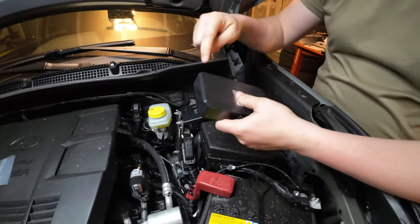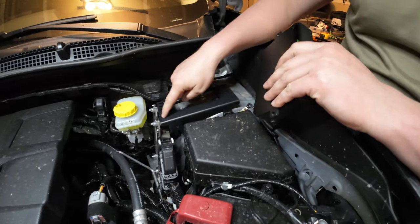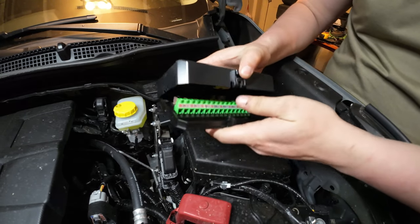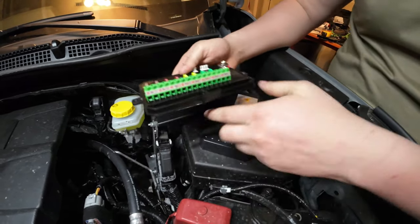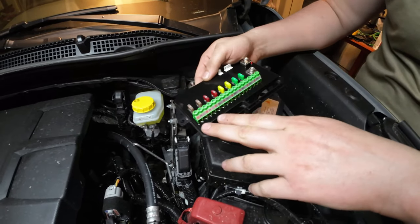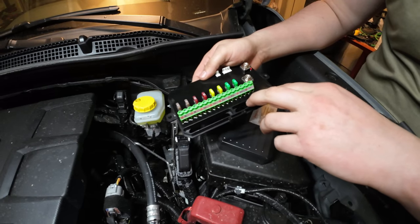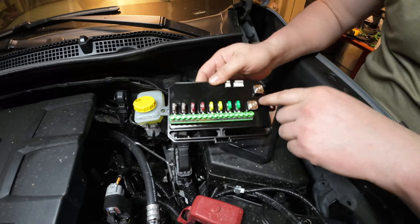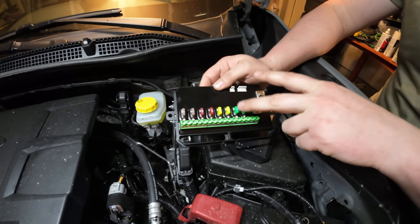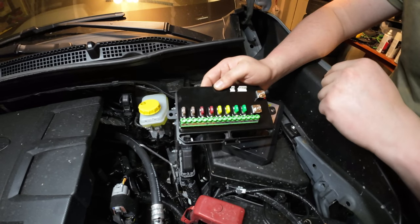This is the control box. It mounts with two bolts — there are some normal-looking holes and some slots. Inside, there are eight different channels with different power levels: the first two can handle up to 5 amps, the next two up to 10 amps, then 20 and 30 amps. This corresponds to the fuses, but you should swap them out with fuses just beefy enough to handle the normal load so that they are the first thing to burn out.